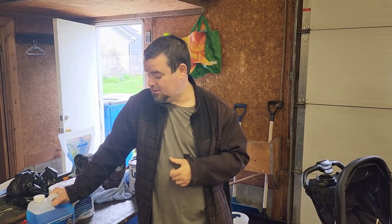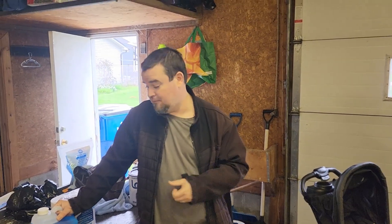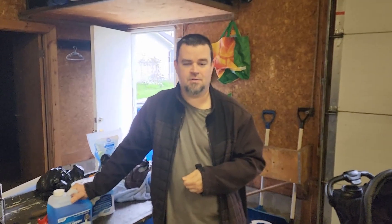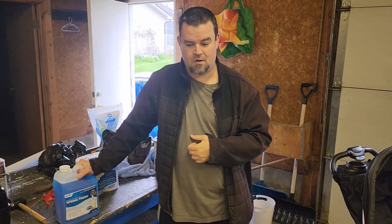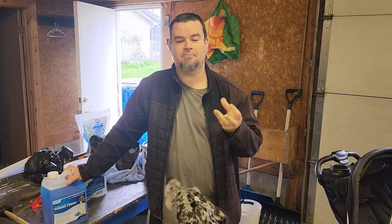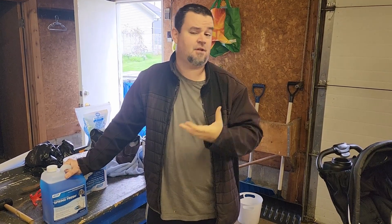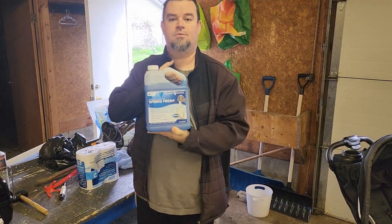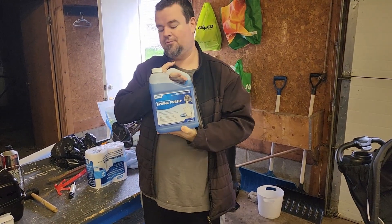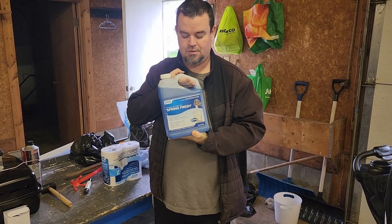Hello, Canadian Campaholic here coming to you on a very wet dreary Saturday afternoon. Speaking of water, today we're going to sanitize the fresh water system on our camper. We do this at least once a year — follow your owner's manual instructions for frequency. Essentially, this involves adding a cleaning compound into the fresh water holding tank, running it through the system, and then flushing the tank a few times. I don't mess around with bleach — I go out and buy Camco's Spring Fresh. I'm not sponsored by them, I bought this myself, and I've used it for several years.